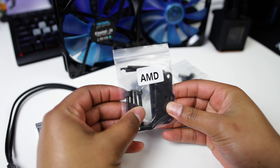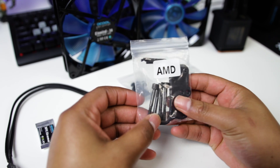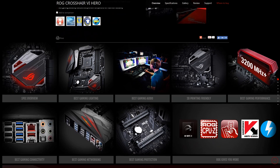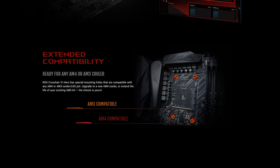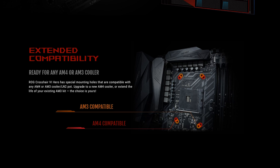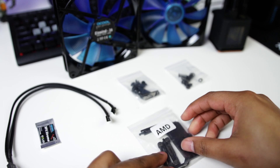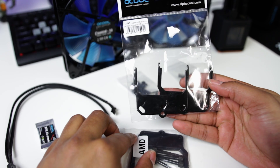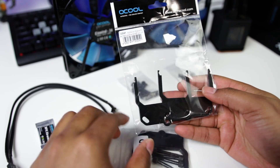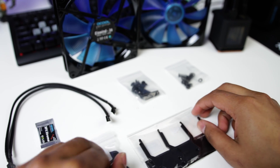One AMD bracket is included, but it's worth noting that the AMD bracket is for the older AM3 and AM3+ sockets. While a couple of Ryzen motherboard manufacturers have done some trickery to support both AM3 and AM4 cooler brackets, most will not. You will likely have to purchase an AM4 bracket if you want to use this with Ryzen — I think they're about nine bucks and you can purchase them from Mod My Mods. I'll have a link in the description.